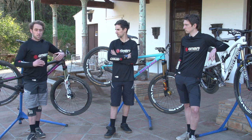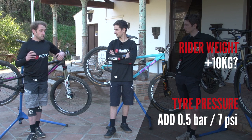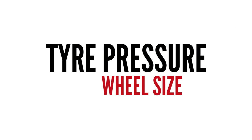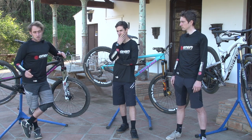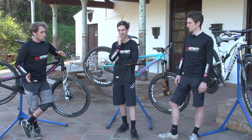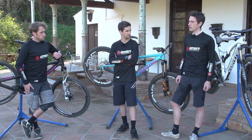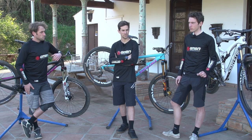Work around that as a starting point to get out there and try it. As far as tyre pressure goes, when I changed from a 26-inch downhill bike to a 650B, there was a minor change — about 0.1 bar harder on the 26-inch. When I went from 26 to 29, I went down by 3 PSI — I used to race at 28 and now I ride at 25. I think the bigger air volume in a 29er means I can get away with slightly softer, or so I think.